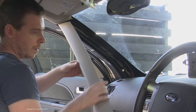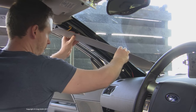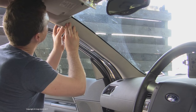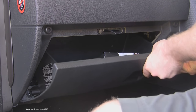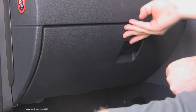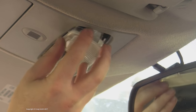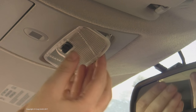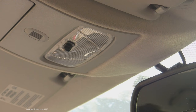Anyway, now we're done with the electrics. I just need to replace the A-pillar trim, making sure the new cabling is securely at home and kept from interfering with the clips. Then the fuse box access can be closed back up — in my case that's the glove box to be put back in. And the courtesy light can be clipped back in, and not a single wire is left visible, except for the very neat one inch of USB cable which goes straight to the camera.